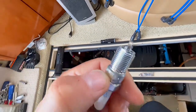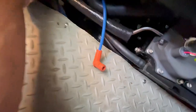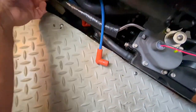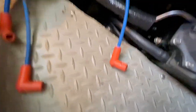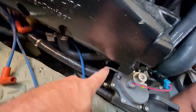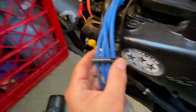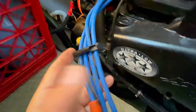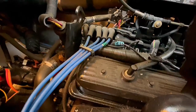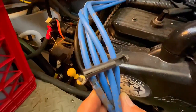I did put a little dab of dielectric grease on them, just to make them easier to come out. I don't want to get my plug wires mixed up, so I'm just marking the old ones with a sharpie — 1, 2, 3, 4. That's not the actual cylinder numbers, just from the front of the motor, 1 being the longest and 2 being the shortest wire. Also make sure you don't lose the clips that keep the wires separated — they protect the wire and keep it from getting grounded out and arcing to other pieces of metal on the motor. Put them back on the new wires.